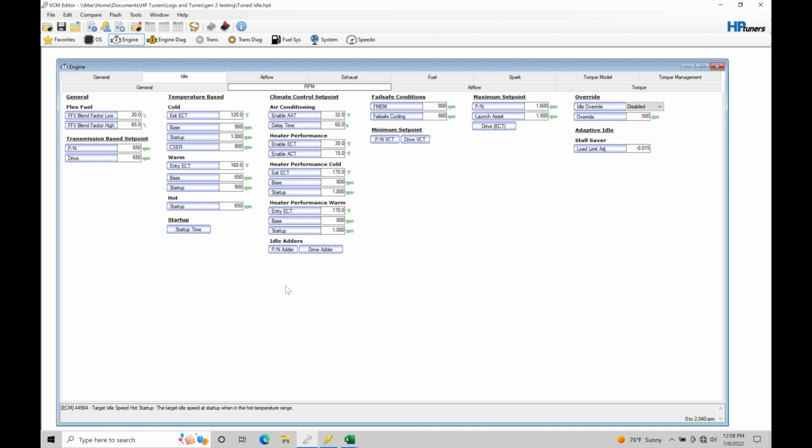Now that we know we've changed those parameters, we need to talk about the cranking fuel and our warm-up conditions and a couple other things associated with that. The variable cam scheduling is going to be known as emissions reduction mode when we fire off the engine for the first brief period of time. Ford's goal is to try to warm up the cats as quickly as possible so there's the least amount of emissions output from the engine. That's usually the worst on a cold engine, and they accomplish that in a couple different ways here. But let's take a look at what we have going on.